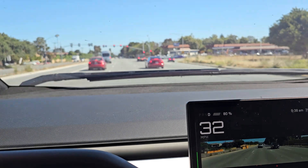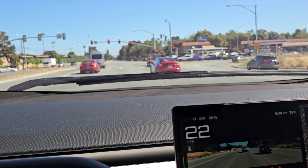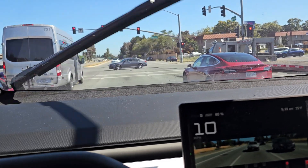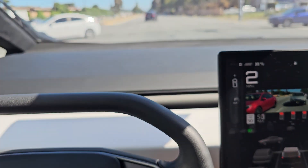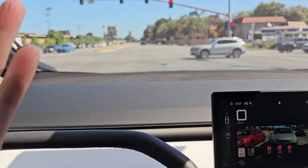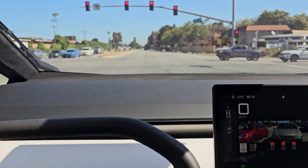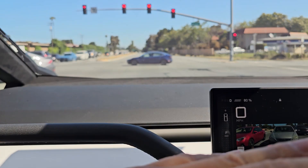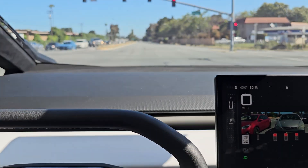Again, like I said, it's waiting for the liquid to kind of go off to the sides. It's assuming if you pressed it once, that it's because you just wanted to wipe rain off. So if it's still raining, obviously you'd either push it again or change it to auto or another speed so it will keep wiping. But if you just pressed it once, it thinks there's some mist that you're wiping down. I'll show you when we're driving faster — I'll hold the button down to spray the washer fluid, and then you'll see it'll go back up because it's assuming instead of rain, it's just wiping the washer fluid off.